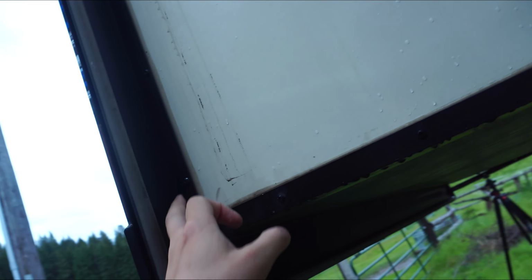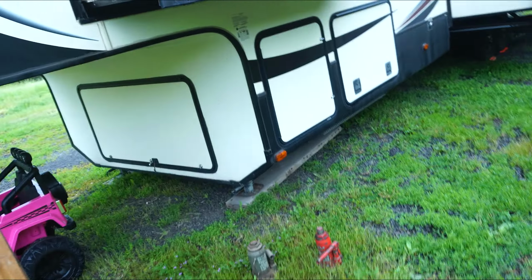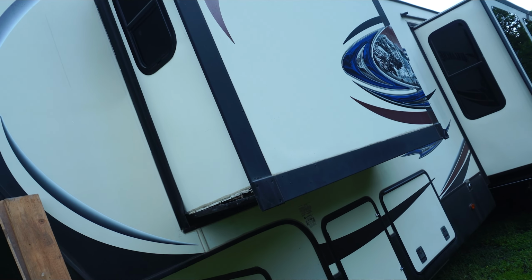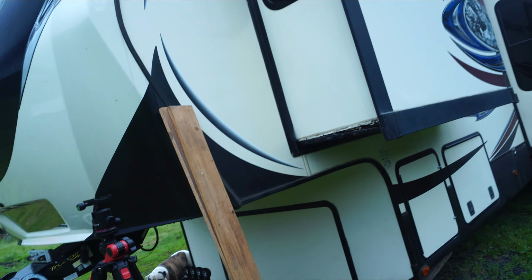Alrighty. So the plan of attack here is there's a bunch of screws right along the top here. We'll get this front lip off first, and then once we get the front lip off, we can pull the other lip, like this one on the other side. This guy right here, get that one out of the way, and then we'll be able to pull that bottom piece out. And then the next step is pull a couple of these screws off, at which point we'll use these boards and those bottle jacks to prop it up. That'll give us a little bit of lift on the sidewall there so that we can get the board out, pull everything loose. But once we get the bottle jacks in, we'll have to go inside and disconnect some things on the inside so that it'll come out a little bit further and basically be free floating. So we'll just watch on the high speed for a minute while I'm getting that all prepped up, and then move on to the next step.